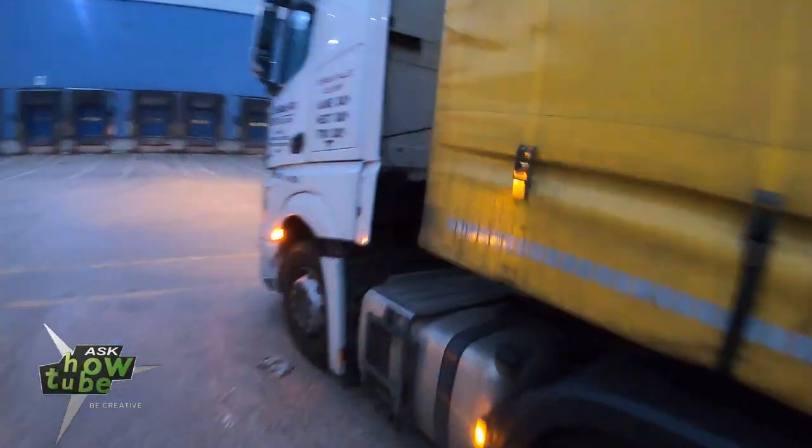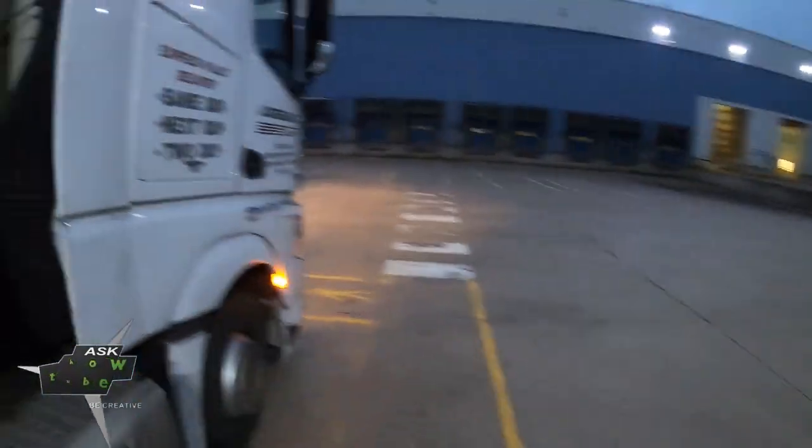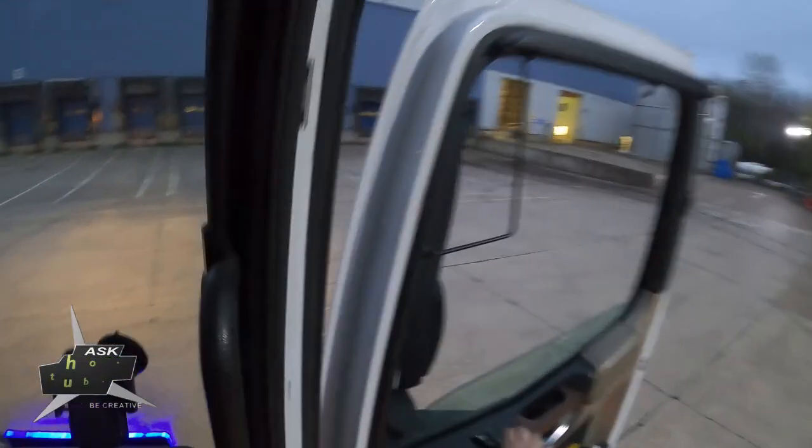This is not my trailer, not our company, so the trailer has a brake press, but every trailer is different, so it might be here in the back. That's interesting that this trailer doesn't, it's impossible not to have, they are here. So red is trailer brake, we press it down, and this is shunting. Now there's no more brakes on the trailer. Okay, but if the trailer is loaded, you need to put the red airline in, because you need brakes on the trailer.